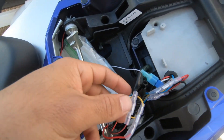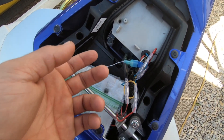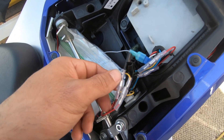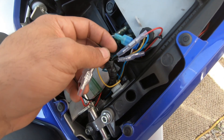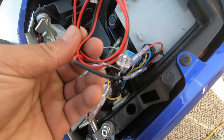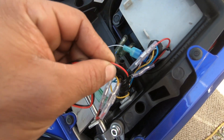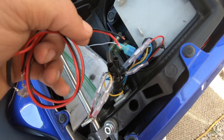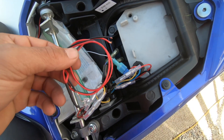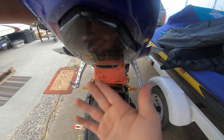I've reinstalled the foot pegs and ran the wires inside the bike. There's not much point in showing my specific wiring since you might not have the same bike - all vehicles are different. I recommend looking at the wiring diagram for your specific year and model, which will tell you what each wire does - for example, a green wire labeled 'right side turn signal.' Make yourself a small LED with a resistor and wire to test polarity: plug it in one way, and if it doesn't light up try the other way. LEDs only work in one polarity - if left reversed they'll burn up. Now let's test the blinkers.